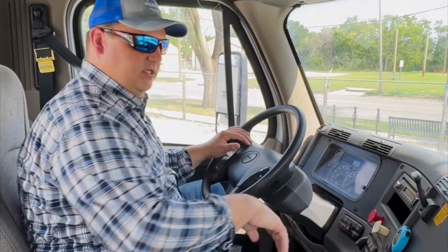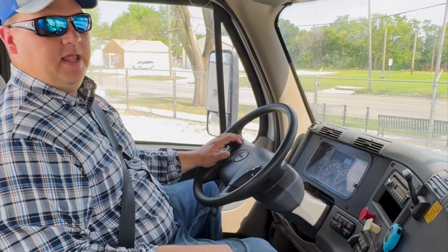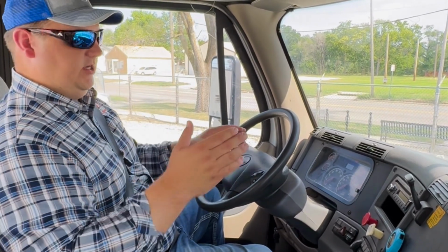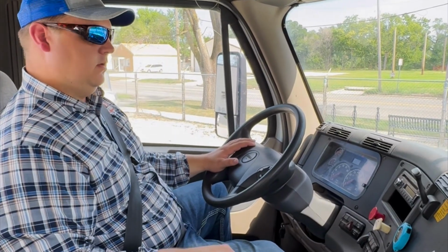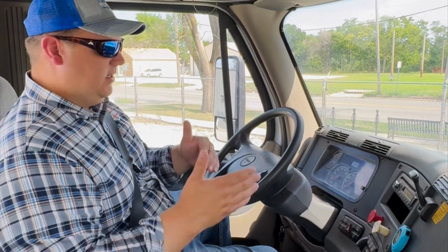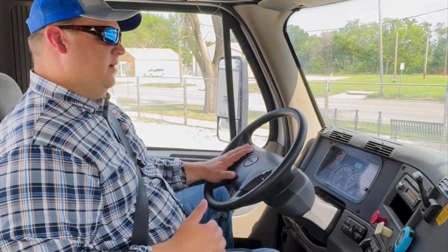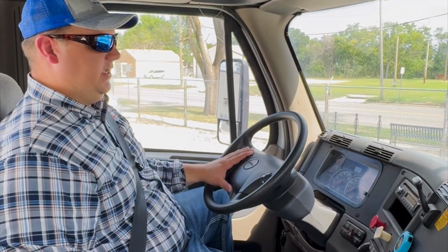So we're going to charge the system with air. Once that's charged, we go straight into the applied, which is apply the brake. What we're going to listen for is for 1 minute, we're going to make sure we don't lose more than 4 psi. With my stopwatch, I would count this full 60 seconds. I would let my examiner know I did not lose more than 4 psi. Once I've completed that, we will go into the L, which is the low pressure indicator.